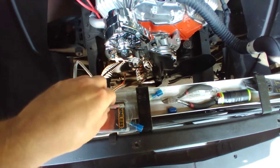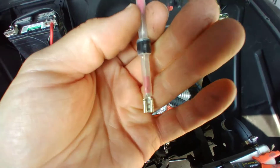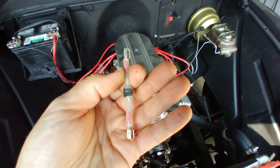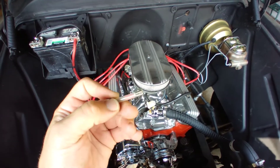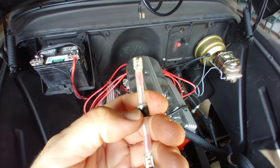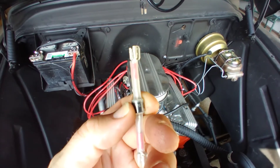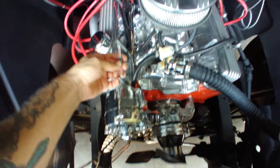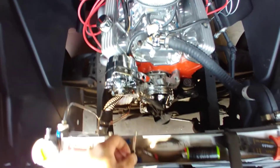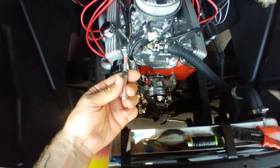To fix this, you need to pick up one of these diodes. I got this one on eBay for about eight bucks. This one is a P600M. Now these don't tell you which direction the current flows easily, but there's a little gray stripe around the middle of this black piece. That gray stripe side is the side you want facing the alternator, which means current flows this direction but cannot go back the other direction.